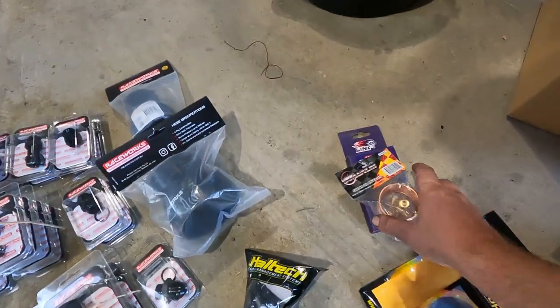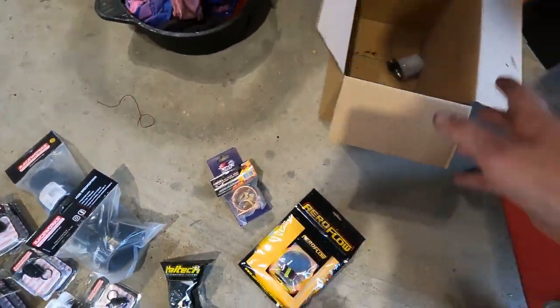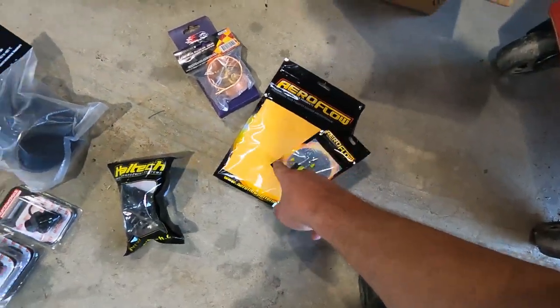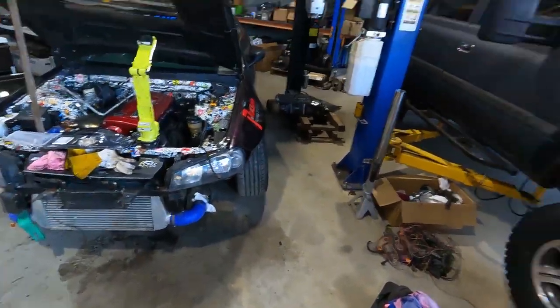As well as that, we've got our E-map set up, which I'll go through when we put that in the car, and we're also going to put a turbine speed sensor in for the Pulsar turbo. We can keep an eye on exactly what sort of RPM our turbo is doing. Not only that, but I'm also going to put an intake air temperature sender pre-cooler, as well as one that's post-cooler, so that we've got data for the actual temperature drop over the intercooler there. So fair bit of data going on, try and make sure we use the most of what this Motec has to offer.